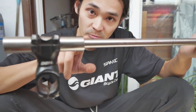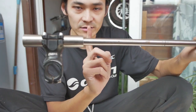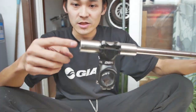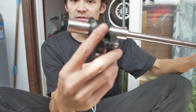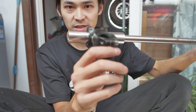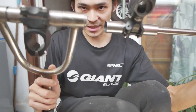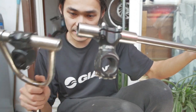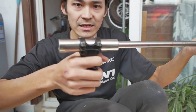I've put one bearing inside here, and the other bearing will go to here, and this smaller 17 mil goes out from this end. So you will have to make another tube connecting to both sides, connecting to the trailer fork as it used to be. So you make something similar like this. You connect this at the end, and now this is fixed with a rolling pin bearing axle.